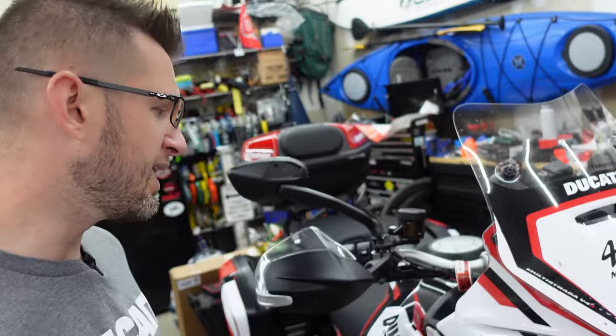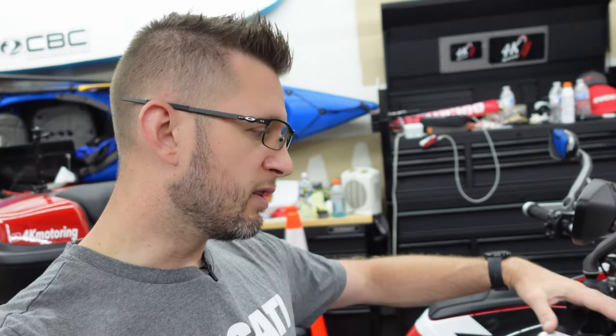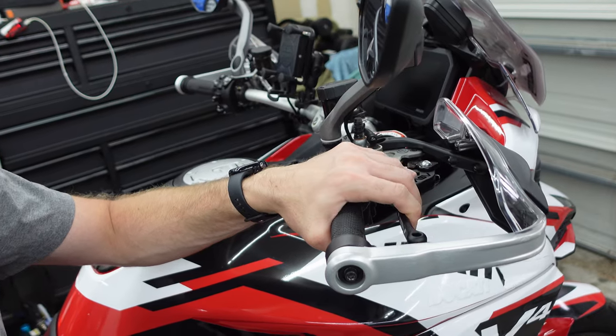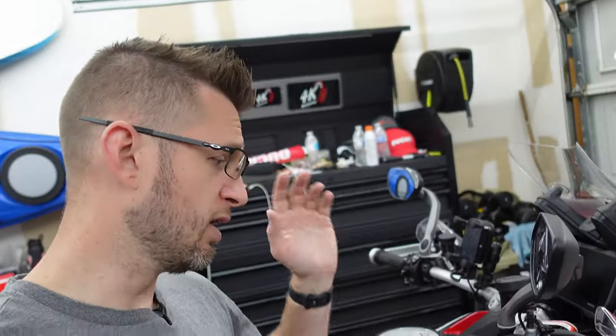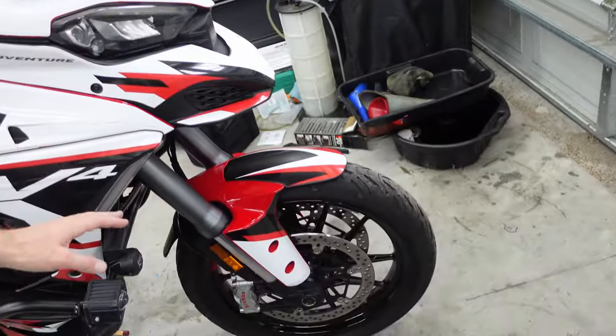I posted a video about this that a lot of you watched and responded to, chronicling exactly what was going on. The brake lever, very typically for air in the lines, would build pressure, squish back almost all the way to the lever, and then on repeat pumps would build pressure and not come back so far — classically air in the lines. There was never any leaking from the system anywhere that I saw, so it was a bit confusing.